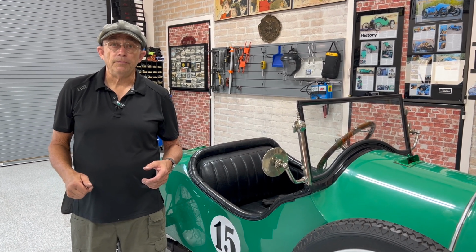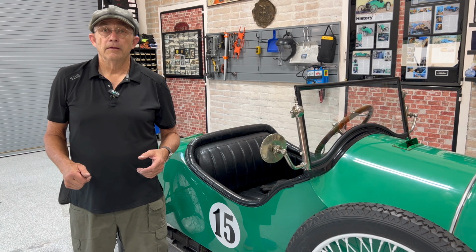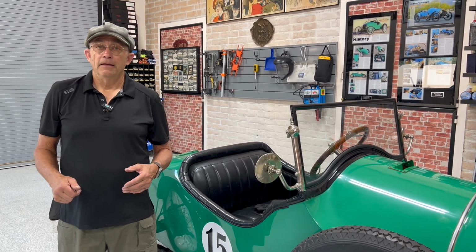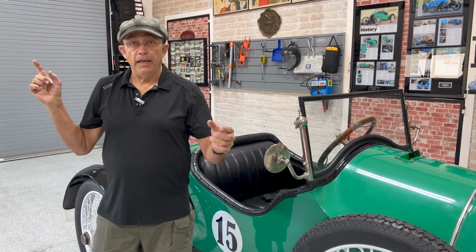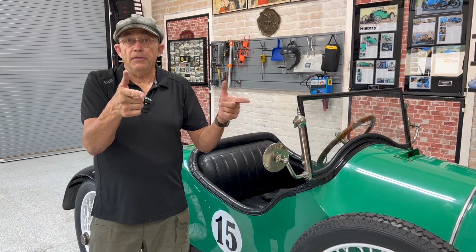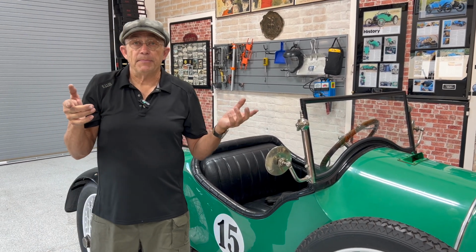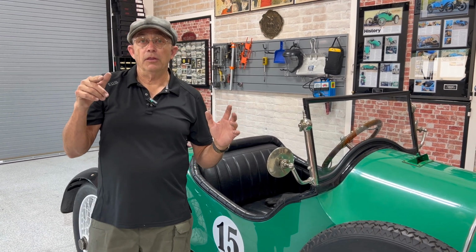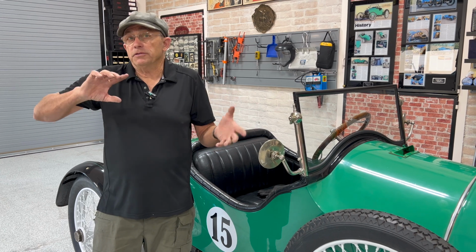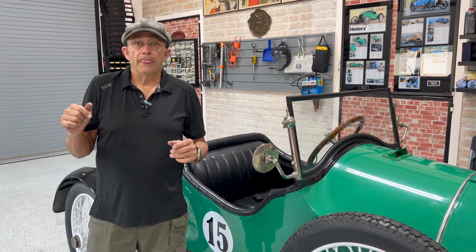So we're always thinking nowadays with hydraulic or even, I guess, electric brakes or using a computer, but with hydraulics, the fluid can equalize itself easily. That's right. But with a cable, you've got to find a way. And this was in the era of mechanical brakes. And mechanical brakes didn't just mean there wasn't hydraulics. There was mechanical rods actuating each rear wheel. So all the rods started in the same part of a bar, and then you had the same pressure exactly on level ground, flat, on each brake. But real life steps in, and if you have one wheel way off the ground and the other one is collapsed or whatever, you have different amounts of brakes. So you could not race it safely. Yeah, inevitably one of the rear wheels will start skidding and not having traction.